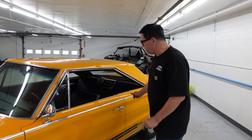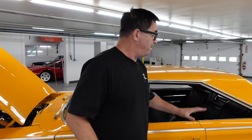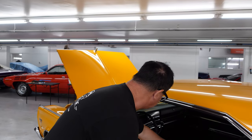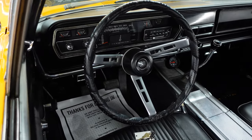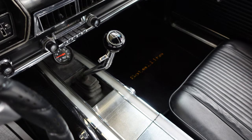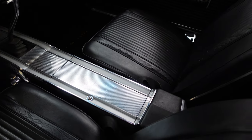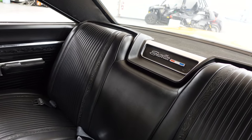This is a Satellite, which means it's a two-door hardtop — the Satellite was not available as a four-door, wagon, or pillar sedan in 1966. They were all hardtops or convertibles. This one has bucket seats and a four-speed inside — the A833 four-speed manual transmission. The console in the middle is factory equipment, and that four-speed is a tough piece, fully capable of handling Hemi power. Nothing like a four-speed manual to connect the driver and the car.